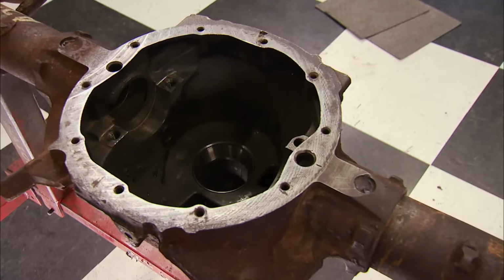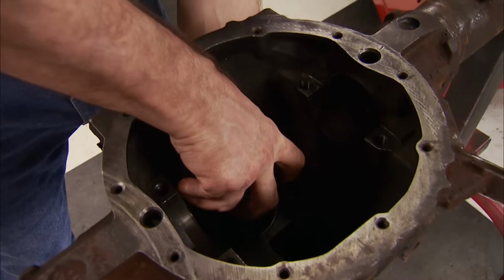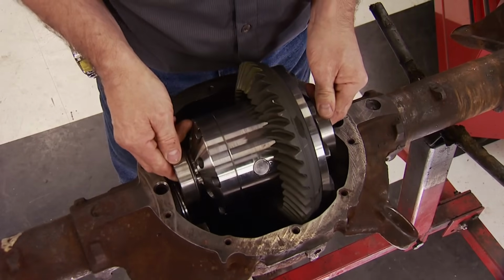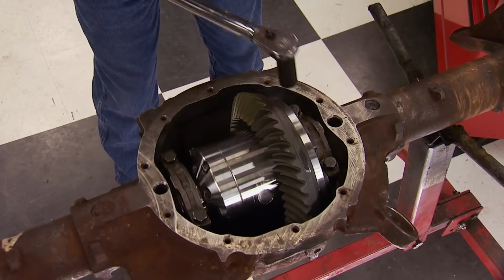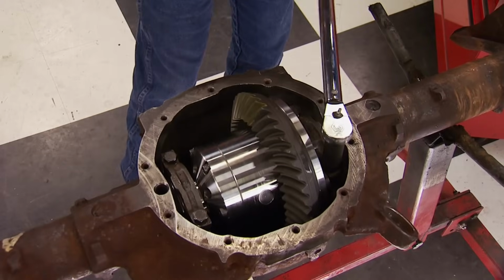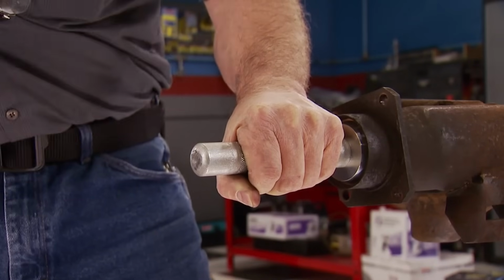With the setup complete, it all comes back out. So the new pinion bearing and ABS reluctor can go on. With the pinion bearing preload back at 16 inch-pounds with the new crush sleeve, the diff drops in for good using the same shim packs. And the caps get torqued to 65 pound-feet. The gear and diff install is now complete. The axle bearings can go in now. A few taps with the hammer and they're installed.